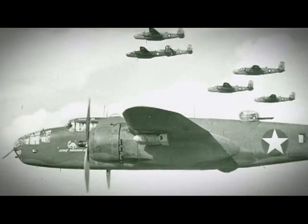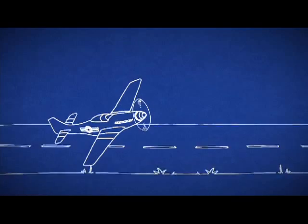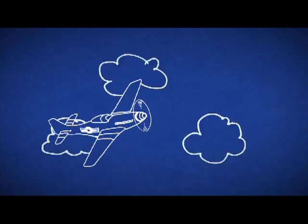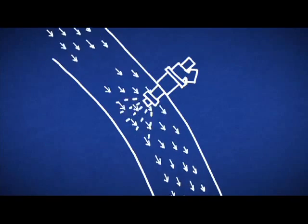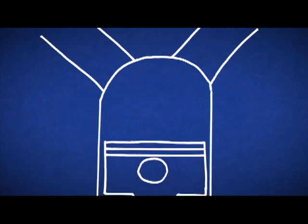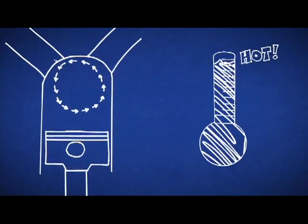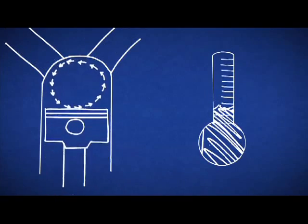Water injection actually dates as far back as the 1930s. It was extensively used for the first time in World War II on supercharged and turbocharged fighter aircraft to increase power on takeoff and increase the altitude at which a plane could climb. Basically, you're injecting a mixture of water and methanol into the vehicle's air-fuel mixture on the way to the combustion chamber. Water methanol provides chemical intercooling inside the cylinder. The water evaporates under the high temperatures in the cylinder, and when the water evaporates, it takes the heat with it. The methanol also has a cooling and octane-boosting effect as it burns.